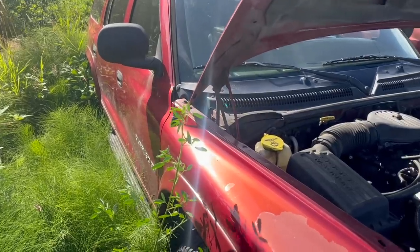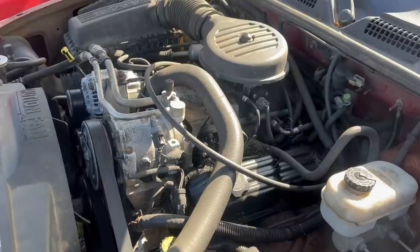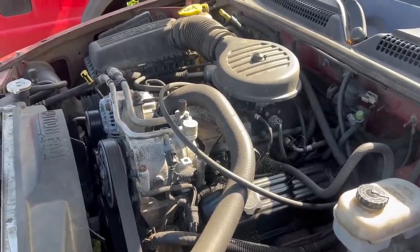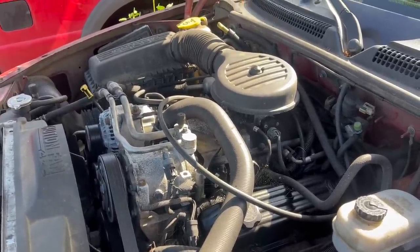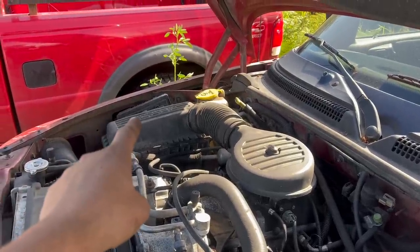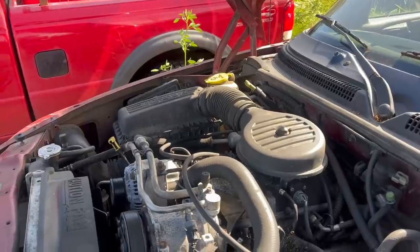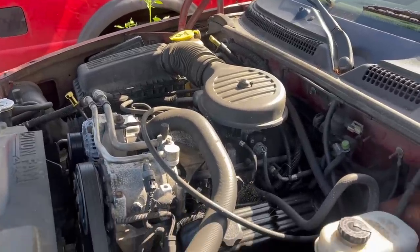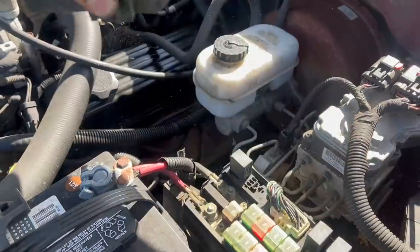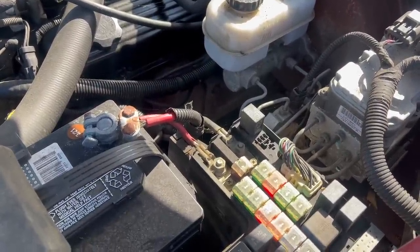This is a 98 Dodge Durango, and it's also a suitable donor, sort of. The oil pan is slightly different for reasons, but other than that, the engine itself is exactly the same. No problems there. The problem is, the wiring harness from the computer on this vehicle is actually integrated into the truck harness. Lighting, that sort of thing, is all wrapped into it. You don't get the one big plug to unhook to bring all that with. You have to take the whole thing, including the box.